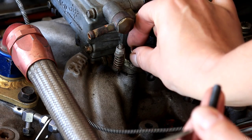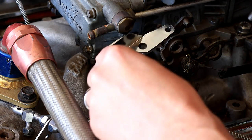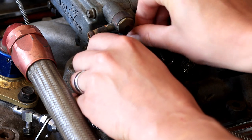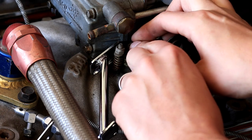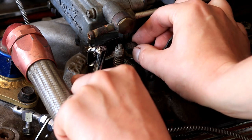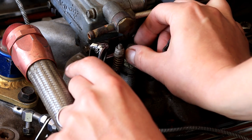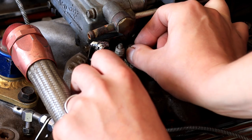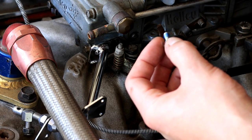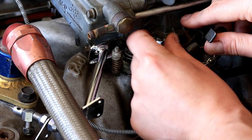Now I just have to apply this spacer. You can apply it on your stud, which you most likely have, but because I'm just using a bolt, I'm just going to set it in place there. Then we can wiggle the bracket in and drop the bolt in, get that started with our fingers. I'm going to put a lock washer on this so I don't have to crank it down too tight and it'll stay in place. I put a little bit of Loctite on the supplied quarter-20 — blue Loctite, because it'll be easier if I ever have to take this off, but it should still hold okay.